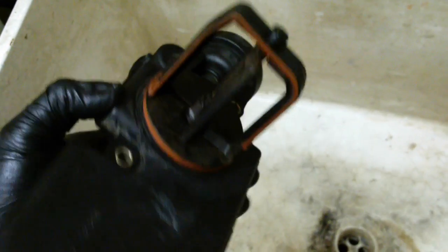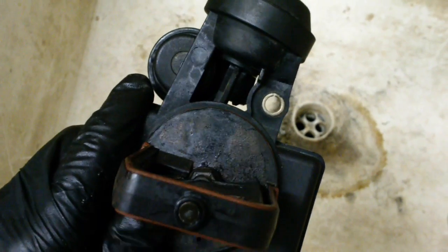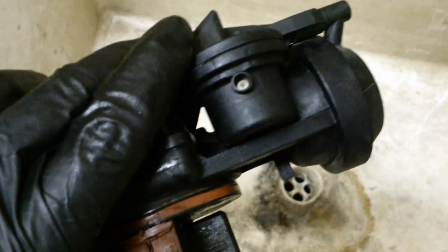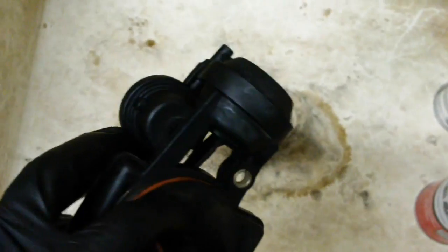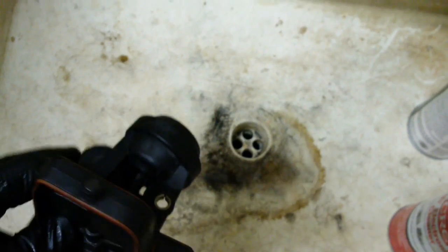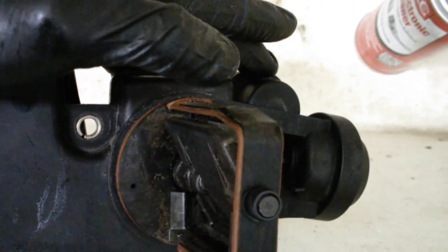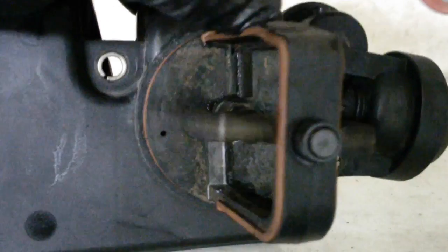The test for the DISA valve to see if it works is: when you go like this, first it should move the piston. It's hard to film with one hand, but that piston moves. The second test is that this is a vacuum device. This is the air release hole right here. You put your finger on it, take your finger off, and bring this down all the way. You close it and put your finger back on the device, making sure you're holding the hole and there's complete suction. When you let go, it should not move any more than about 20 degrees — that's the maximum — proving the vacuum is still intact. And when you let go, it flips down.